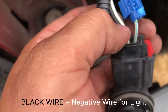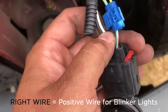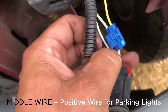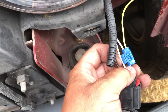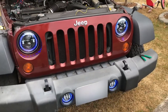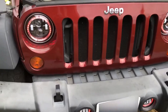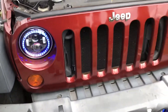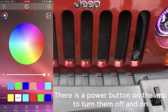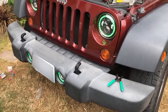Mine is bluish and greenish with a white line, but so is the one in the middle, but it's opposite of the black. The black is the ground. This is the turn signal, and this is the parking lights. We don't want it to go off all the time, because if you did parking lights it would always be amber — we want it to only turn amber. It'll come out of the color into the amber if you hook it to this one. So now I have them all hooked up. I haven't wired up the parking light yet, but I have it ran directly to here and here. In the app there is a power button at the very top that you can turn them off with. I'll probably end up hooking them to an accessory port inside the fuse box.